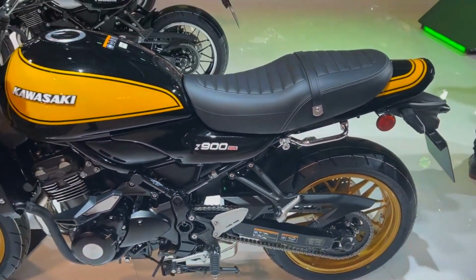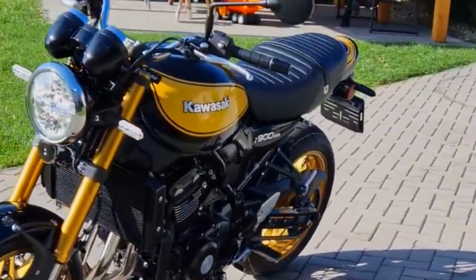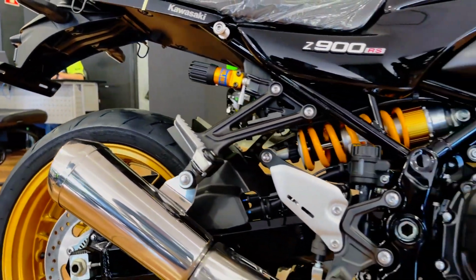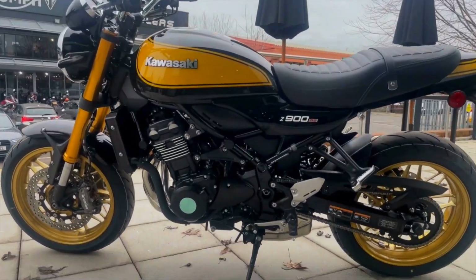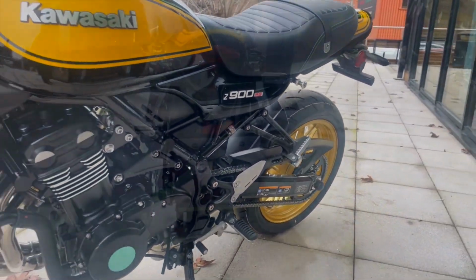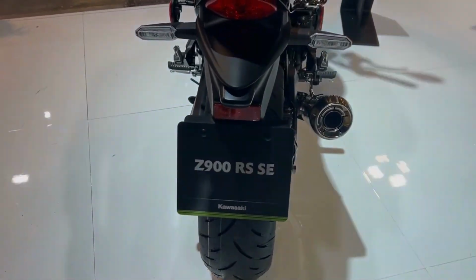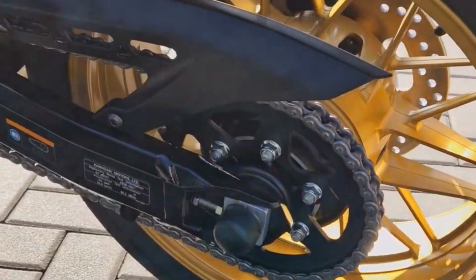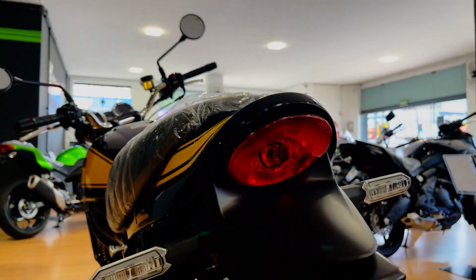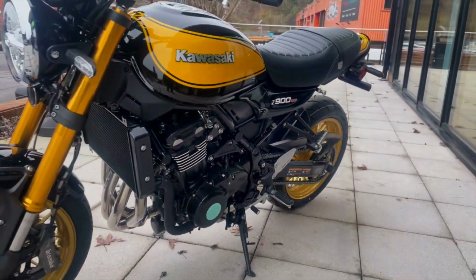Brembo front discs with a diameter of 300mm, M4.32 radial mount brakes, and smaller diameter monoblock pistons increase brake power. A Nissin radial pump master cylinder with steel braided lines also enables a linear progression that makes precise control easier. This Öhlins rear suspension enhances the comfort of riding and provides a more immersed sensation, working in tandem with the large diameter inverted fork. The gold fork outer tubes complement the Öhlins rear shock and add to the bike's striking look.